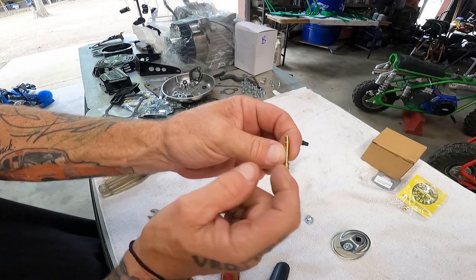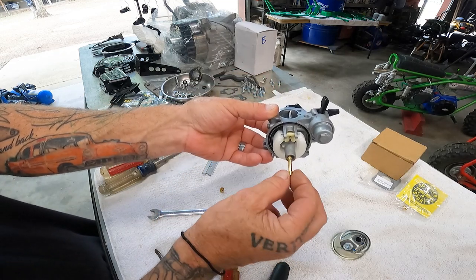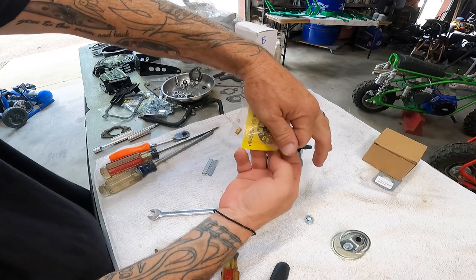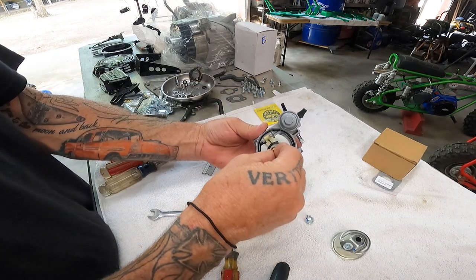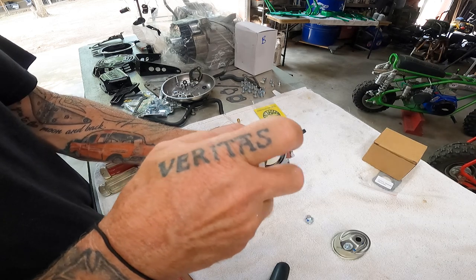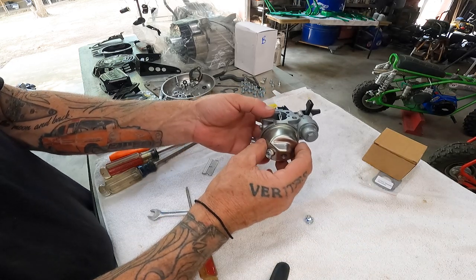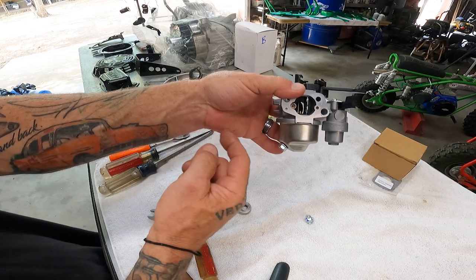You have a big end and a small narrow end on your emulsion tube — the small end always goes up inside the carburetor first, because this is what's going to protrude through the main body of the carburetor. We'll just take the small end, slide it back in there, let that sit. Get the supplied jet they sent with the Stage 1 kit. Drop that rascal right in there. Line my screwdriver up — there we go. You don't have to get it crazy tight, but make sure you get it a little snug. Don't over-tighten it — it is brass going into aluminum. Just give it a good snug.